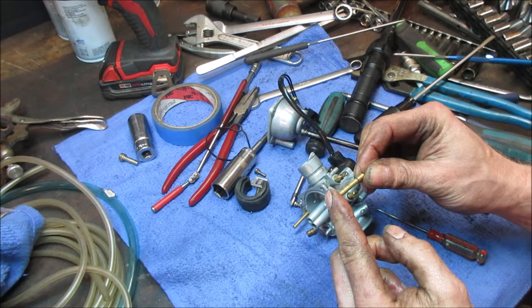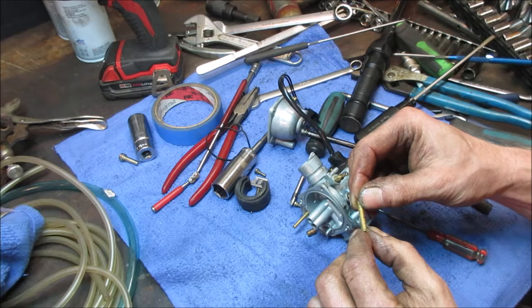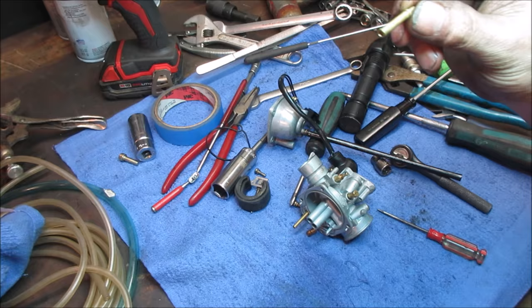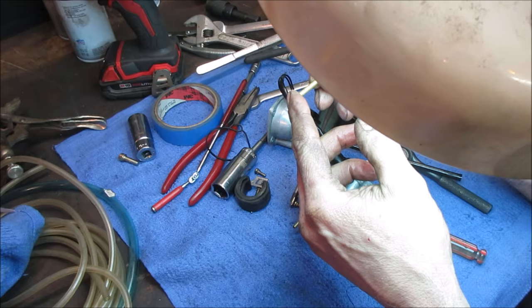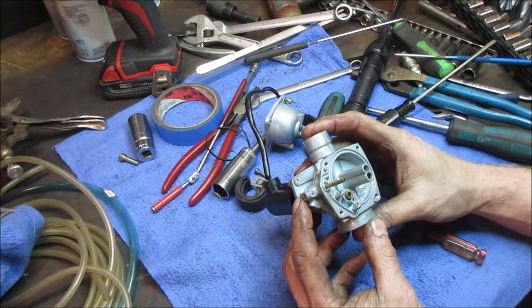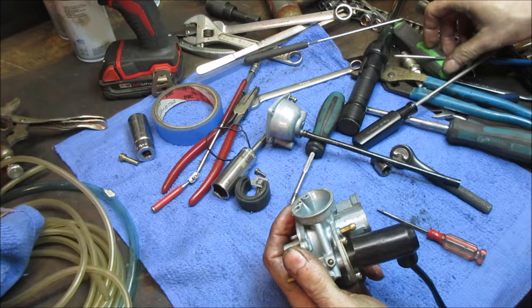around there. Sometimes they have an O-ring on that part of it too. Let me go look real quick underneath the... Yeah, I do not see them being clogged. I should have taken that apart. Just learn that every time, tear the carb down to nothing and clean it. Let's get that enrichment, electric choke, whatever you want to call it, out of there.